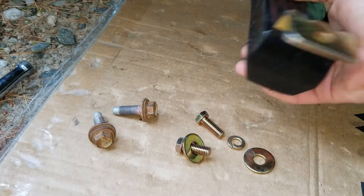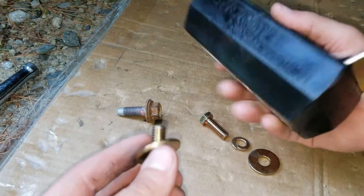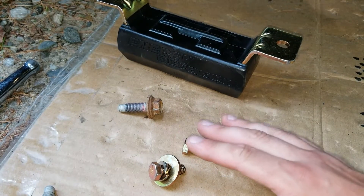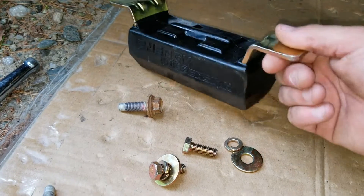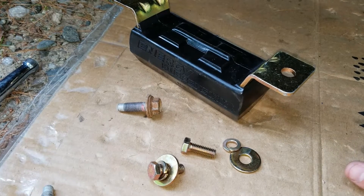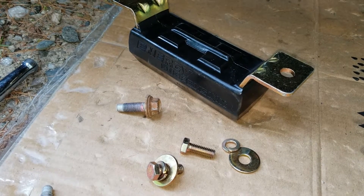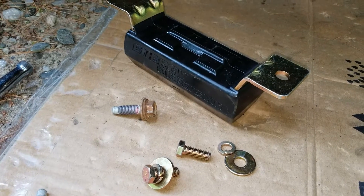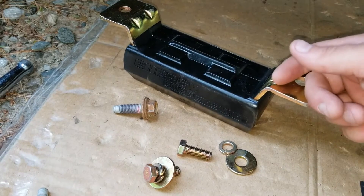Here's how it goes on — this gets mounted up to your transmission with the factory bolts, they just go in here like that. Then these bolts get thrown in right here in your crossmember. However, I'm not going to put the bottom bolts on right now, because the next step — part two of this video — I'm going to be taking this crossmember out. I'll mount this back up into the transmission, pull the crossmember out, get it in the garage, clean it all up, and paint it. This crossmember is going to be a test run for me checking out this paint — see how good I like it. If I do like it, we'll probably finish the rest of the underside of the truck with it.